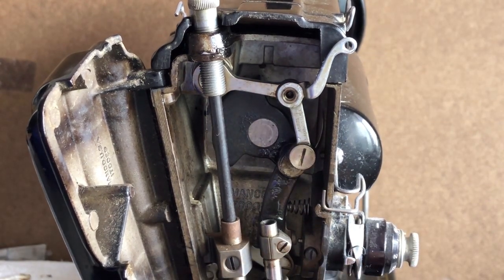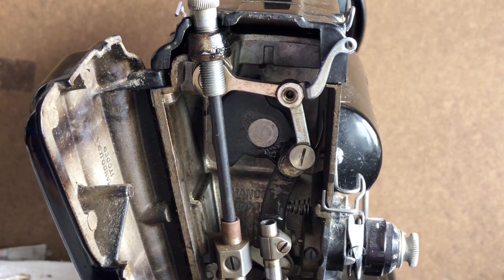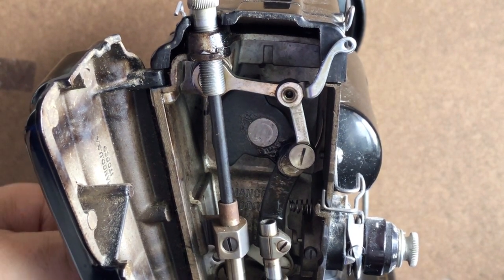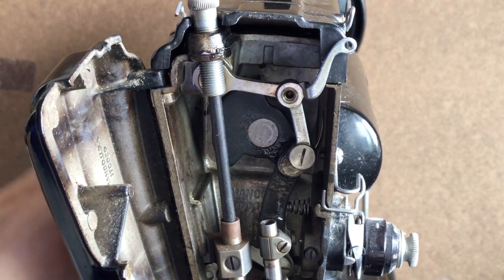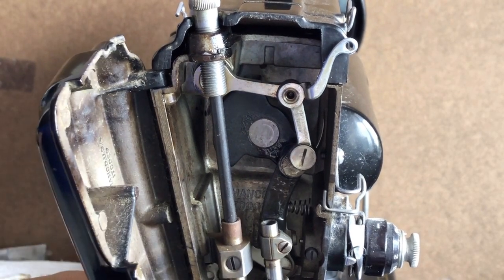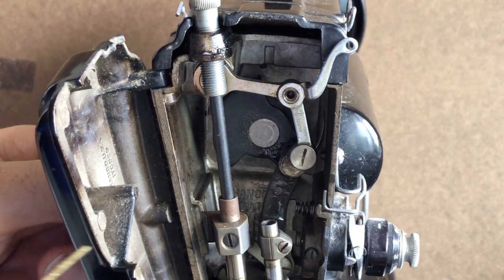The presser bar also needs lubrication. I'll put some here, pull the presser bar up, making sure it's getting some lubrication. There's a little line at the very top where dust and old oil would have stopped — you can see that little line where that's as far down as the shaft goes. You can take alcohol and remove that if you want, but the main thing is always have a fresh film of oil there.